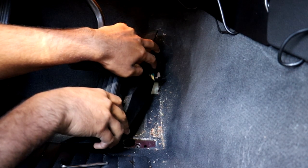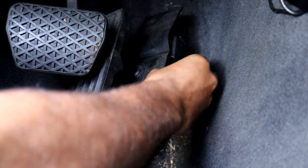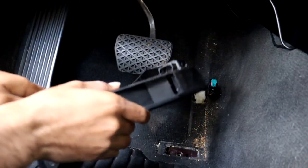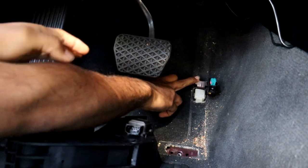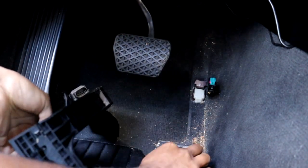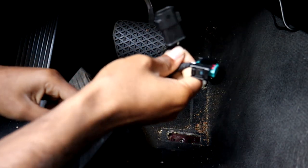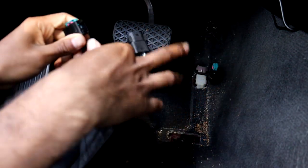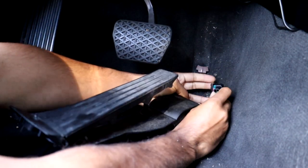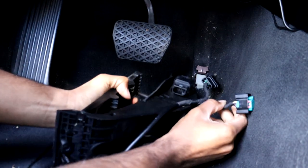You can see there's a little electrical connection right here that I'm going to disconnect — just squeeze the two tabs and pull downward. There we go, it comes undone like that. You can see that's where it was hooked into back here on this little metal piece, and then this little spike right here was hooked into this hole on the side. Now that the pedal is out, we're going to take the end of our pedal tuner that connects into the pedal — this side plugs into the car, and this side plugs into the actual pedal.